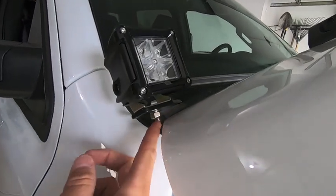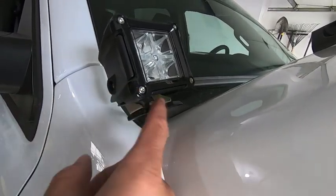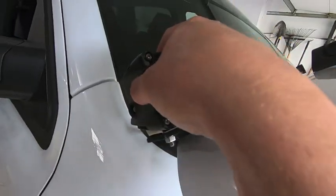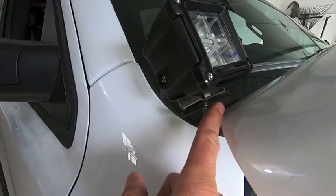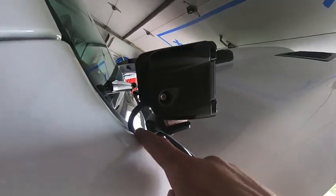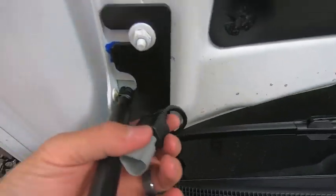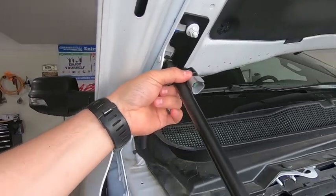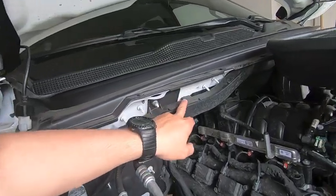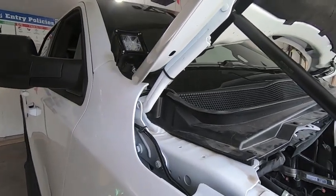I got the OZ LED pods installed on the brackets - it's a very close fit, so be super careful with your paint. If you pull the light as far to one side as possible it gives you plenty of clearance; this is a very solid bracket. Just loosely put everything in there until you can aim them later at night. The wire passes from the LED and tucks up underneath the Z-Roads bracket, then comes out right here. My plan is to zip tie it to the hood struts and then run this power wire across to the other side.